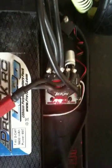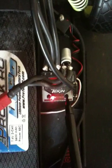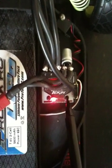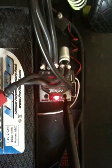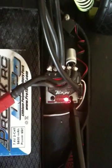Now I'm going to show you how to make a quick adjustment that's really popular in off-road, which is the drag brake adjustment. It's the first LED on the decal. What you're going to do is hit the mode button one time — it's going to have the LED flashing on drag brake. The first time you hit the increment button, that's just going to show you what the current setting is. If you want to adjust it, keep hitting that increment button and you can see the LEDs climbing up on the LED tree. The higher they go to the right, the more drag brake you're going to get. I'm going to show max drag brake, which is all the way over to the 7 LED, and leave it lit.